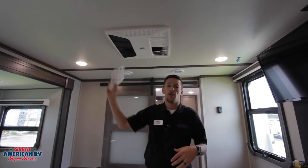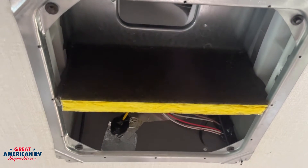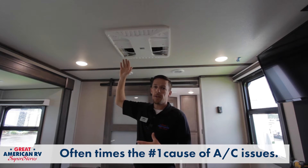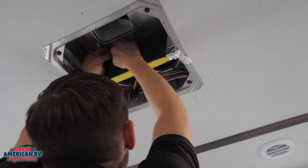Another thing we can check is our divider on the interior, to make sure we're not mixing air. We have this divider in the middle that has foam on the sides and on the top. That foam will begin to deteriorate over time and will allow cold air to come in on our return side, causing a lot of humidity inside, keeping those fins wet, and allowing it to freeze up. Once it freezes up, it's not going to allow air to circulate and your unit is not going to cool. We want to make sure this stays sealed really well. If it doesn't look sealed or you see air blowing through, we can get this silver HVAC tape, put it on the sides and across the top where it meets the top unit, and make sure we're reducing the airflow between the two.